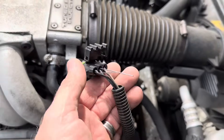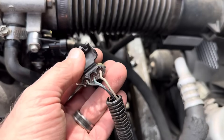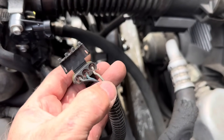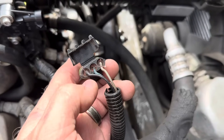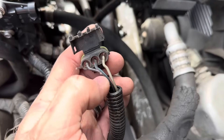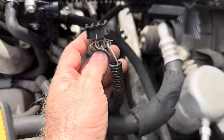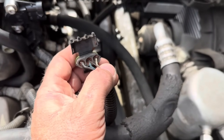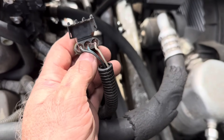On each side of this there's a little clamp — if you pop that open, this is welding wire. It's real thin — I think it's 30 or 40 thousandths. Real thick welding wire won't go in there. So the way this works: the ground is up top, the blue one in the middle is the sensor wire, the white one is the power. We have to measure the voltage between these two. It's a five-volt sensor — five volts comes in on the white wire, the ground is the black wire, and the blue wire is the sensor wire.